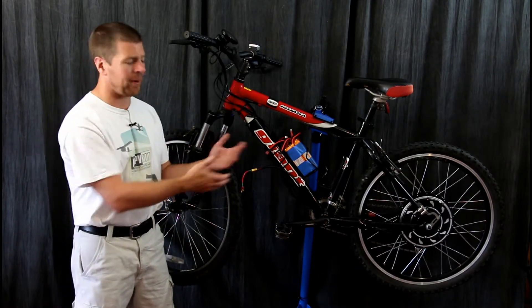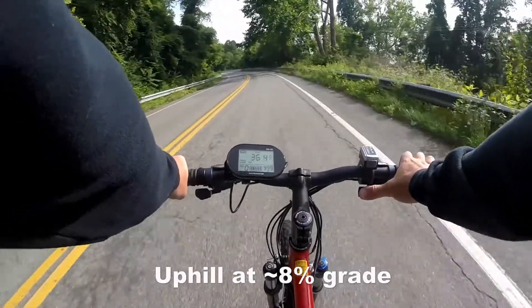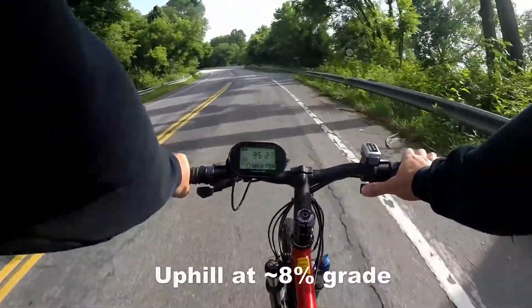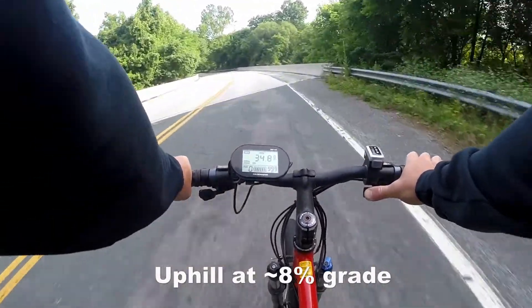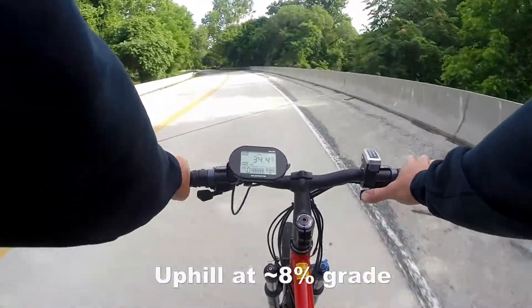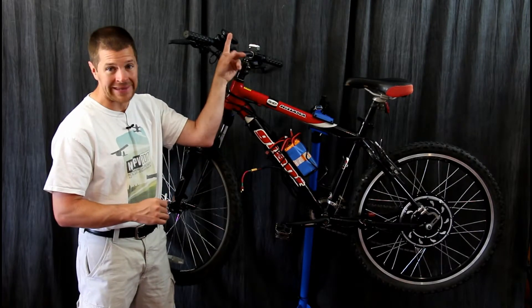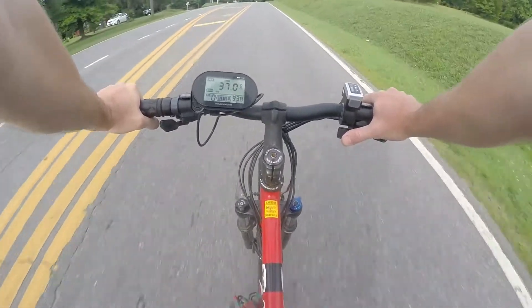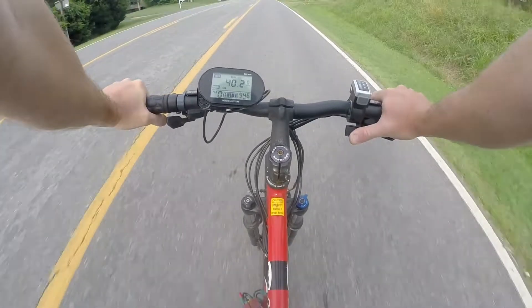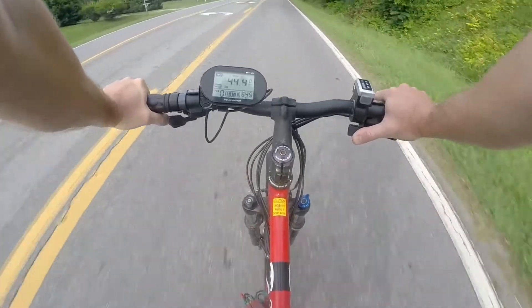What about power? How powerful is that motor? Very powerful — I was surprised. I was expecting 400 to 600 watts, and that thing is putting out somewhere between 1200 and 1500 watts. It climbs hills with absolute ease. I'll go a little bit faster if I pedal, but that motor will outdo my legs 10 to 1. When I hit the throttle, my watt meter up here is peaking out showing 999 watts, and I know it's going well beyond that. When it starts to drop off as I get up to speed and I start to pedal, my legs are only adding about 200 to 250 watts, and that's if I'm really cranking on it.